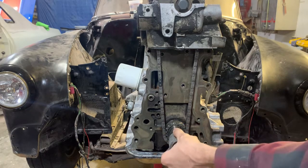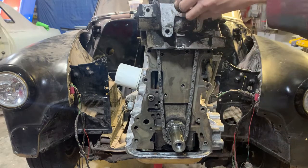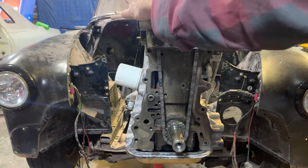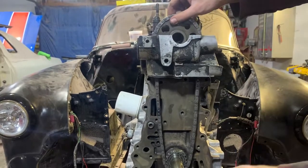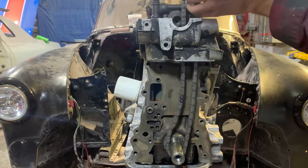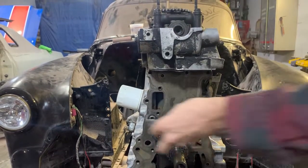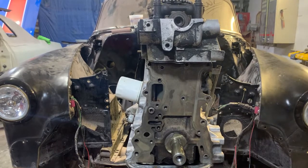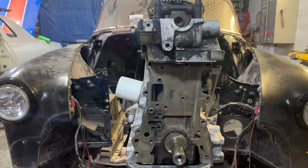All right, slide this off of here. Then we're going to pull your cam bolt out all the way here, along with the distributor gear. Should kind of rock this back and forth. Can you see that? Drop it down. Slide your chain off your gear. Bear with me, I'm new to being a camera guy. Pull this off here. These are well lubed, that's why they came off so nice. And there's your complete timing chain disassembly there.